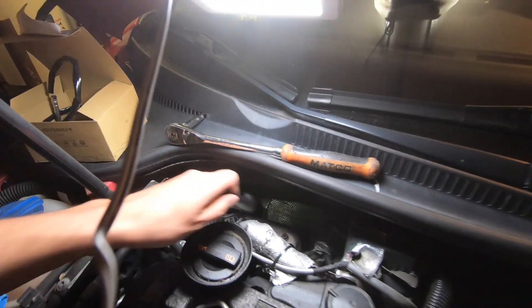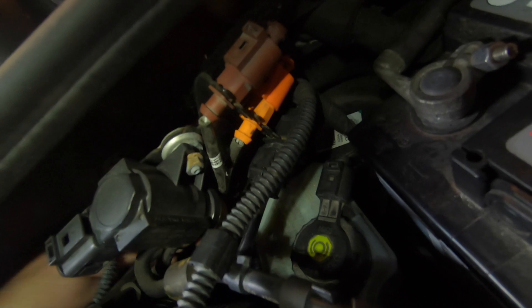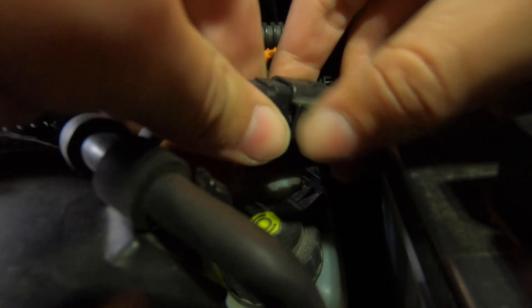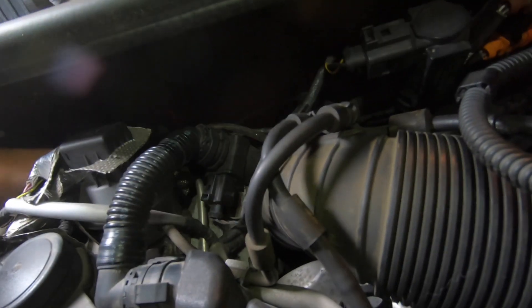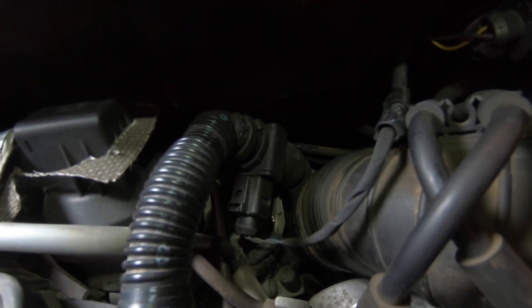I've got a long ratchet with about a three-inch extension on it. My hand is just right here — that's how far down your hand needs to go, like just past your wrist. Now is a good time to unplug your sensor connector from over here — it's underneath all this stuff. Pull this backwards a little bit and it comes out. From here, just note how the cable is routed as it comes out through those hard zip-tie holders. Obviously don't do this hot, and make sure you keep the wire off of hot pipes once you've installed the new sensor. There's a clear zip-tie point from the factory you can reuse when you reinstall.